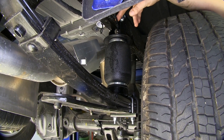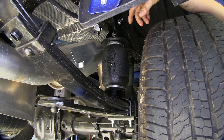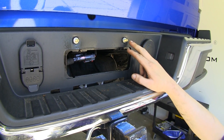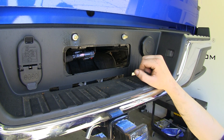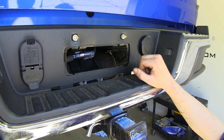It's going to have independent lines for the left and the right side, so you can help even out that load going down the road in case you have an uneven weight distribution. The operating range on these is between 5 and 100 psi — 5 being an unloaded vehicle and 100 being the maximum load rating of 2,000 pounds. Do remember that this extra carrying capacity does not increase the amount that your vehicle can haul; it just supports that much weight to help even out that load.